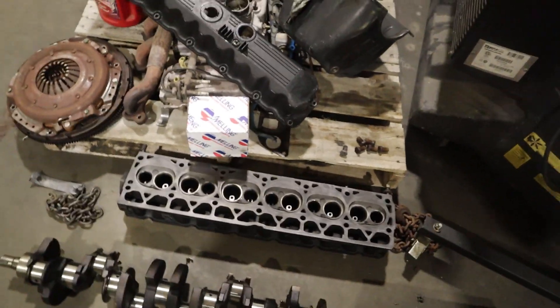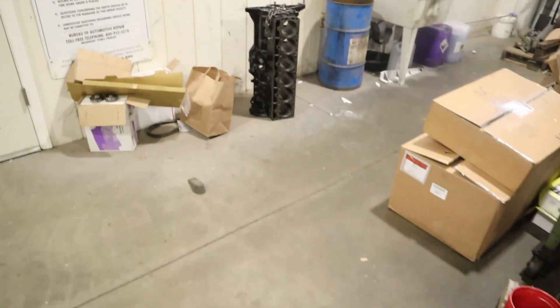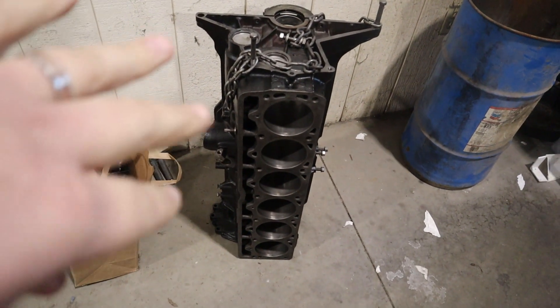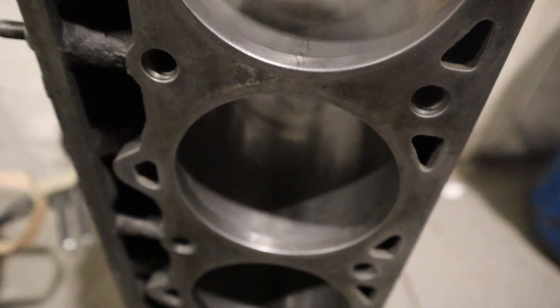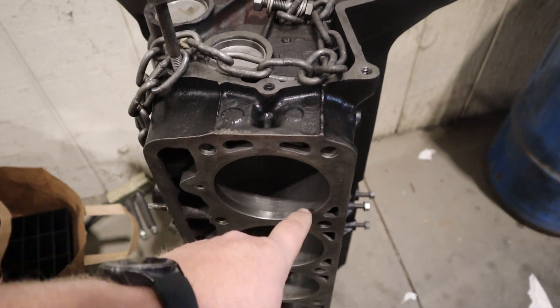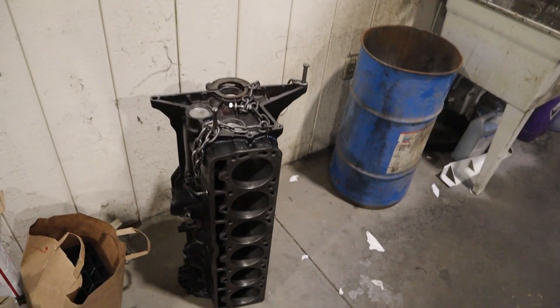The porting and polishing is going to do enough to get the flow we need for the stroker. We've got the original block — it was bored 30-over when we went through it. I took a bore gauge to it and it looks really good, like it's hardly been run. It still has really good cross-hatching. I measured it and there's about two ten-thousandths of wear over the top of the bore — in ten years, that's a pretty good amount of wear, meaning it held up very well.